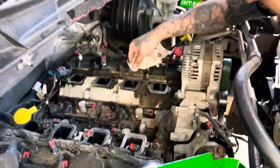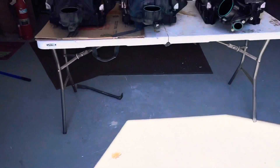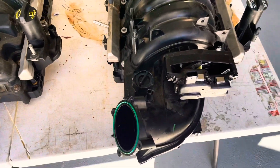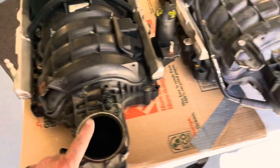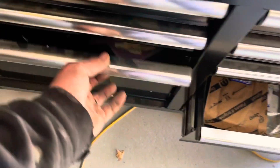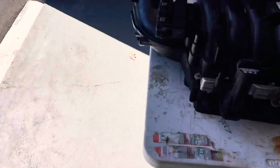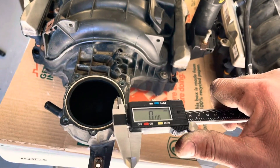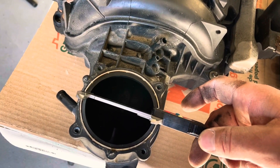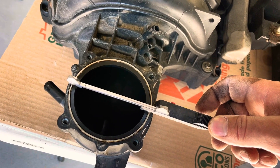Bruno is cleaning his surface over there on his heads. I'm going to come over here and grab the caliper. This is a stock 5.7, this is a ported 5.7, and this is a stock 6.4 intake. We'll check the throttle body openings, flip them over and check the runner openings as well — all the intake runners.